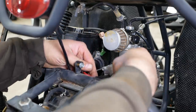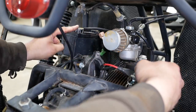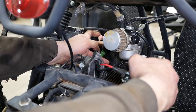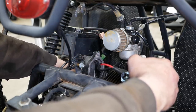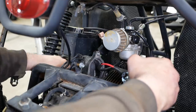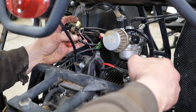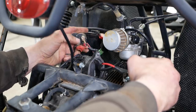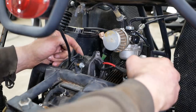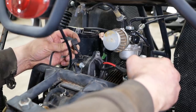The wiring is all messed up. I don't know what happened here. So there's a red wire that runs from the starter, and it goes right over here to the negative terminal of the battery. If you look at the positive terminal of the battery, it even has this little boot that says 'positive' on it — that runs down to the starter solenoid. The other wire from the starter solenoid — oh, here we go — there's the starter solenoid right there. The positive side is all melted. Anyway, one side of it goes to the positive side of the battery, and the other side is actually connected to this bolt on the side of the engine. It has a little boot here with a negative sign on it.